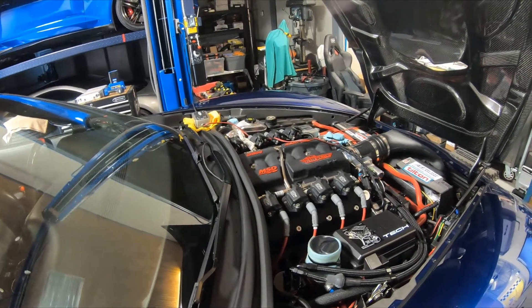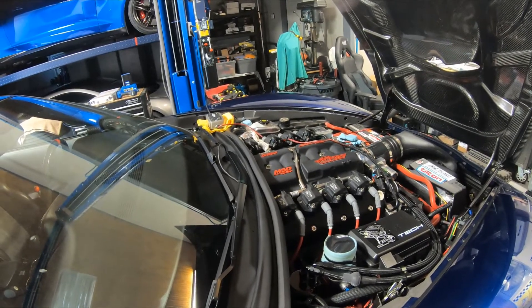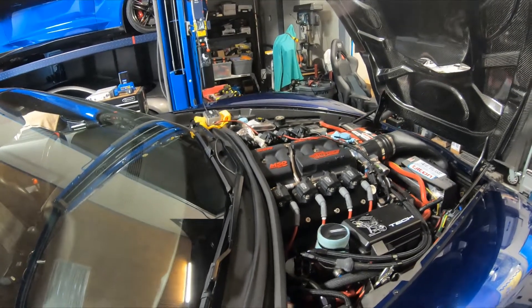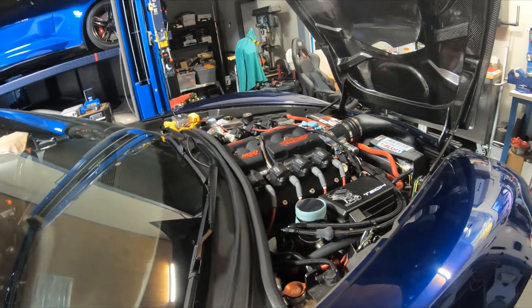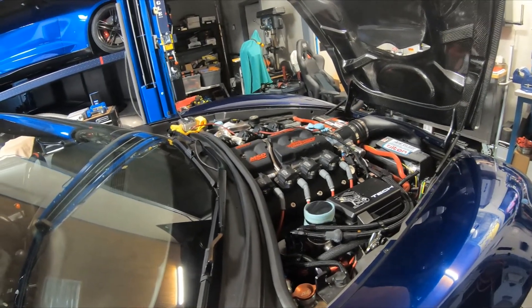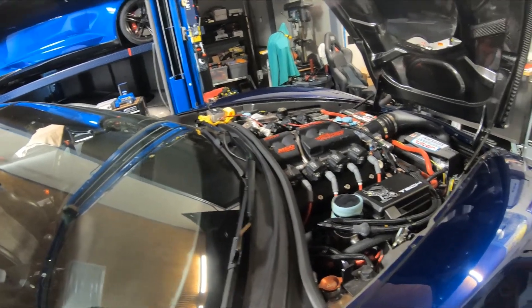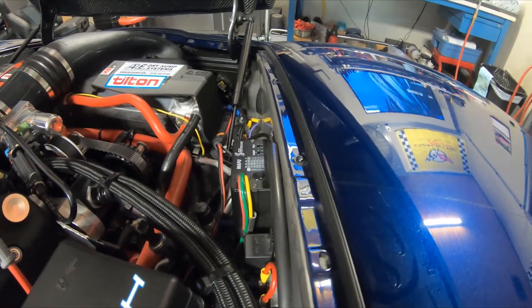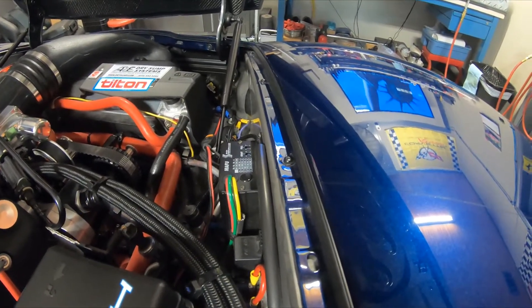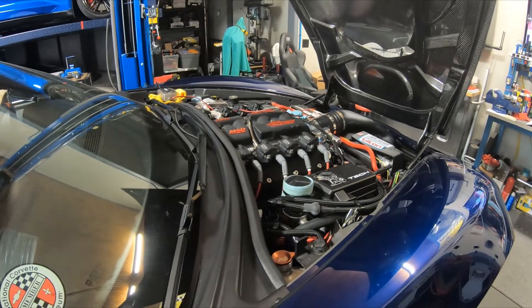So it's a very nice track car. Runs good. Run 100 octane on the track and 93 octane for the street. I have a water methanol injection system so you don't spend that much time at full throttle on the street. You can run 93, and there's a device to set the injection based on airflow. I use the windshield washer tank on the side as the container — holds about a gallon and a half.